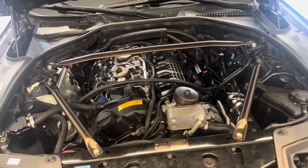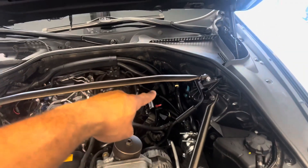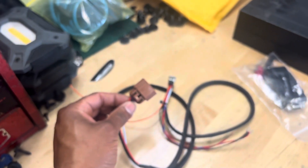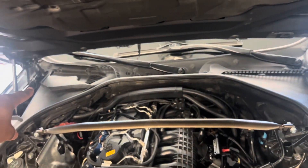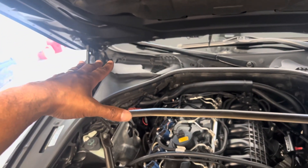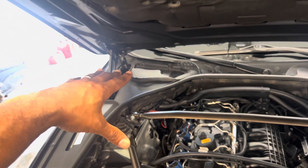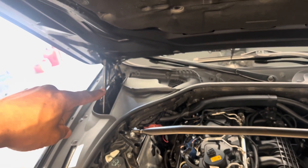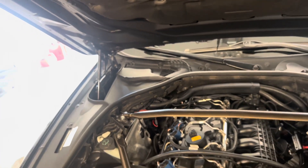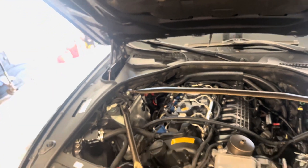So if anybody's going to do this kit and you want to take an E85 sensor, I'll put a link in the description to my previous video where I showed how to build your own setup with the E85 sensor and the pressure sensor. You can leave out the pressure sensor or add it if you want. To get this connected, this end of the connector is going to plug right in to that Continental sensor. I'll end up running the other unit over here to a little cubby hole above the AC blower motor. We're going to tap into the lines there for the CAN bus system as well as our power and then run to a ground.